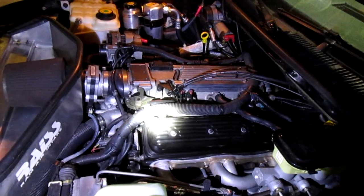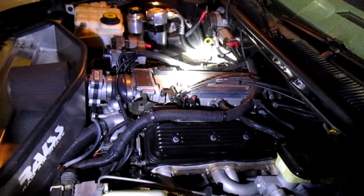This POS starts better with these crappy multi-tec injectors that do leak. I might talk to South Bay — maybe they'll try to clean these. Check valve on this, I should really find one. Those are the other injectors over here — the gray ones, blue with the Ford logo. Now he actually changed it in his description: he says they flow 25.2 or something, cause that's what everyone really came up with when they flowed these things. It's not 24 pounds, it's like 25. And it screws it up — it flows too much, like a pound more. And it messes it up.